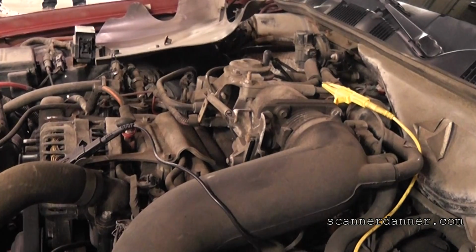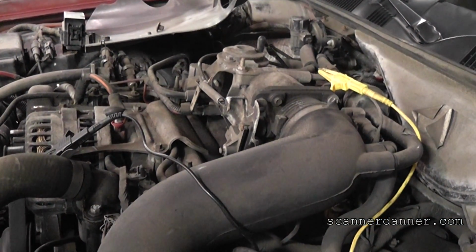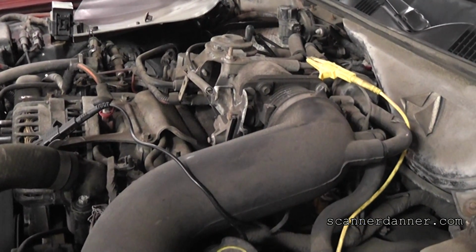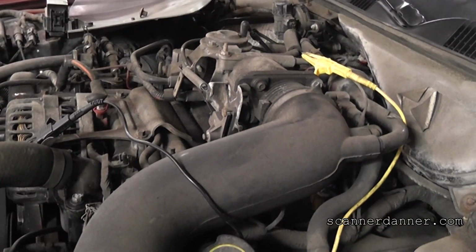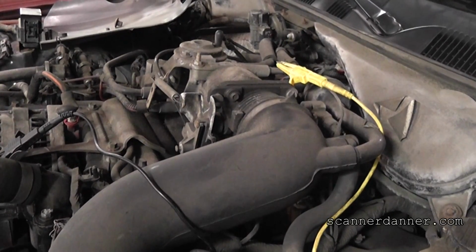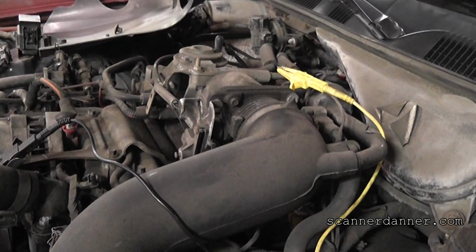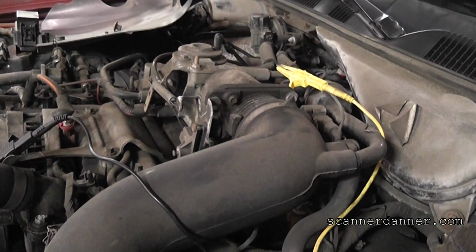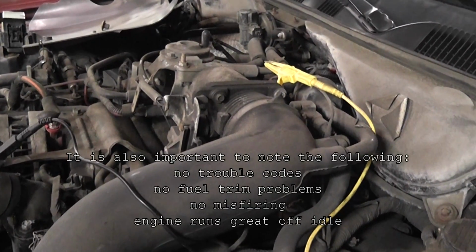And one more time, you guys are gonna maybe wonder why we didn't just smack on the valve. That's pretty much a field acceptable method when you get one of these Fords to come in that do not idle on their own. And there's nothing wrong with that. In fact, I do it myself. But what I want you guys to understand is the wiring checks involved, that if we smack on this valve and the idle does not come up, are we comfortable putting an idle air control valve in this with the checks that we just did?